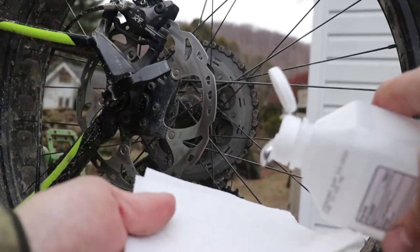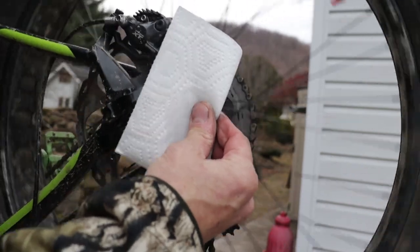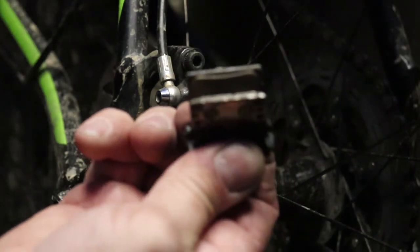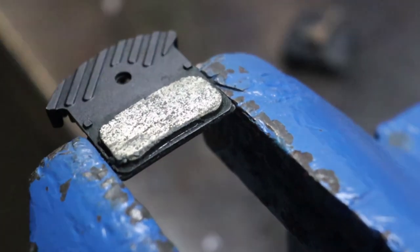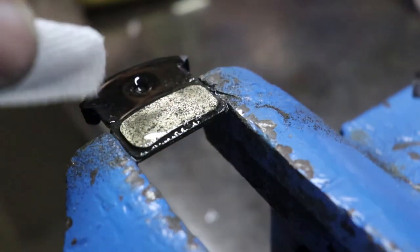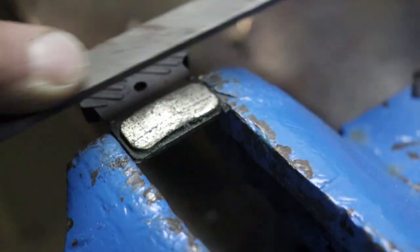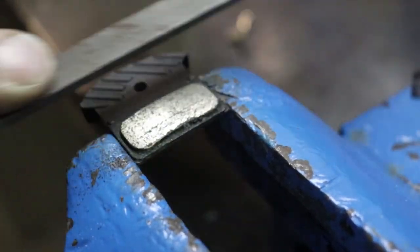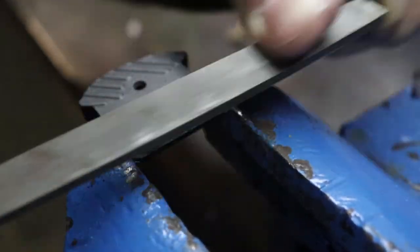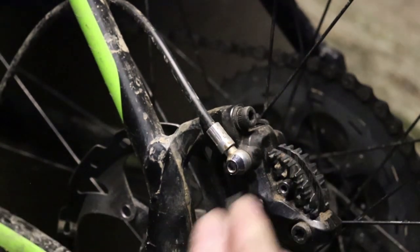The instructions say to wipe and rinse the rotor with more isopropyl alcohol. I suspect that my pads may have gotten some contamination on them, so I am going to take them down to the bike cave and see what I can do with them. Here I have the pads loosely clamped in the vise with the braking surface sticking up. I am first going to scrub it with a little isopropyl alcohol, followed by a few strokes with the file. Sometimes if they are oil contaminated, you may have to hit them with a torch or heat gun to boil off the contamination — that will be our next plan of attack should this fail. Remember, when you install your brakes, some manufacturers such as Shimano XT have designated right and left sides of the pads and springs.